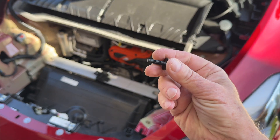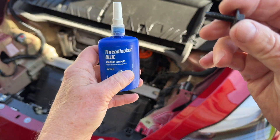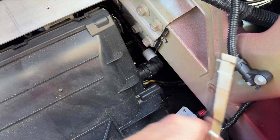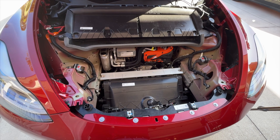I've got my microfiber towel packed underneath there, and now I'm going to get this screw in from the back side. Now because the mounting bracket is plastic, there's a limit to how much you can torque this screw down, so I'm going to use some thread locker blue on the threads. Once it's started I'm going to get my socket - there is plenty of room to get back in there to tighten it. Once the screw is starting to come through, you can go ahead and snap your module back into the holder, and you're ready to put everything else back together. Before I do that, I'm going to go inside the car and make sure everything works.